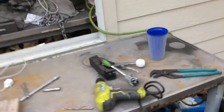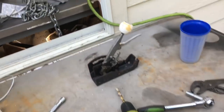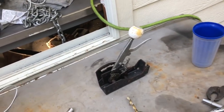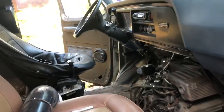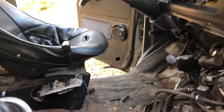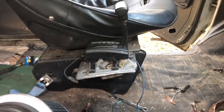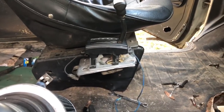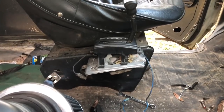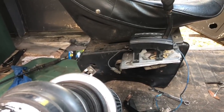Oh, there it is. I bought an old used B&M Pro stick, but the $70 for the AOD conversion deal, yeah. And on top of that, the front exit cable is a huge issue, just for fitment, to get the doghouse in and out. The Mustang shifter, on the other hand, the cable rear exits. So I think what I'm going to do is run this little dealio and just drill a hole in the floor and run the factory cable down.